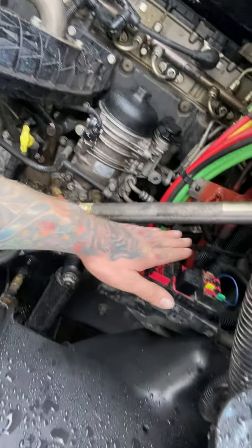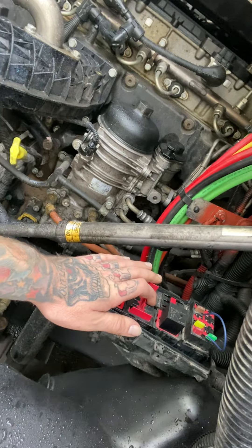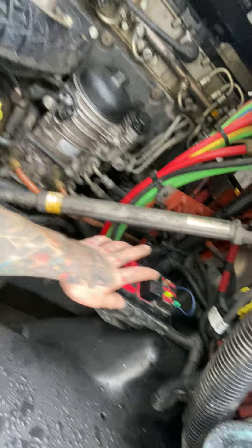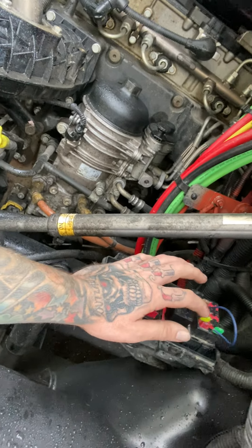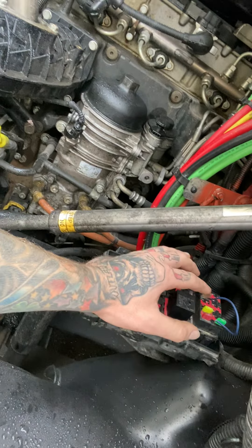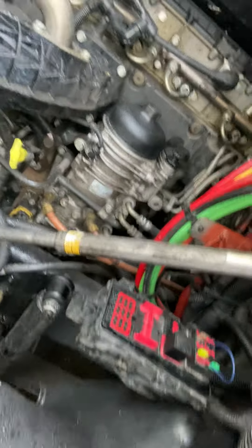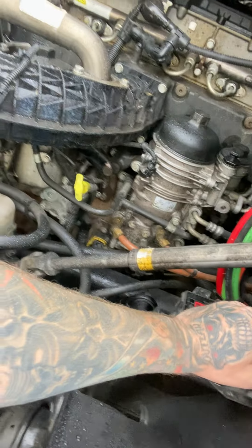Went ahead and popped the hood. First thing I looked at was the top was missing on this fuse panel right here. I started looking at it, took my power probe and started checking voltage across these fuses. I had about two volts right here, about three volts right here, had none on this 30 amp, had 12 right here. Checked the bottom side of it and I had 12 volts. There's a lot of corrosion in there.